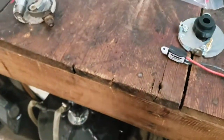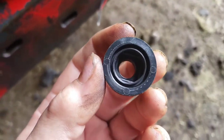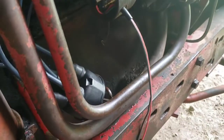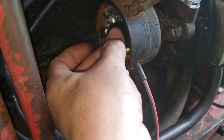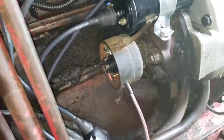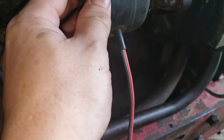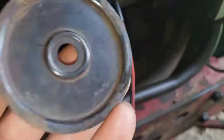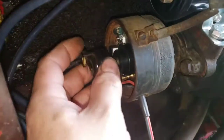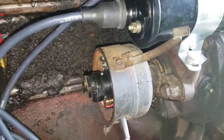We'll get to getting that all put in. Now when you put your magnet on, you can see it's actually square — line up with the squares on your distributor shaft right in there. When you slide it on, it seats down all the way. You probably won't be able to put your dust cap on because the magnet sticks up a little too far — you might need to modify it by cutting the center out. Then you put your rotor on and your cap.